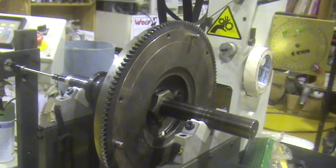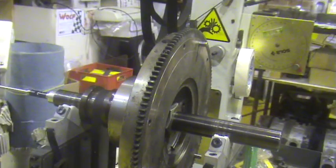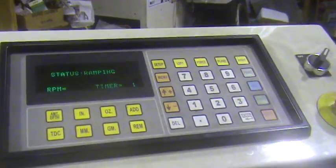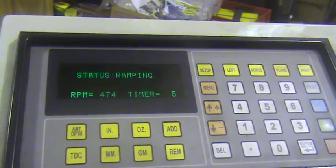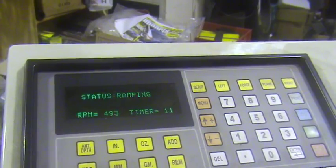This is generally done when you're taking your original flywheel out to put in a steel billet for high-revving purposes. Once it's installed in the jig, we spin it up and that gives us the offset weight that we log and then transfer to the new counterweight being installed on our jig.